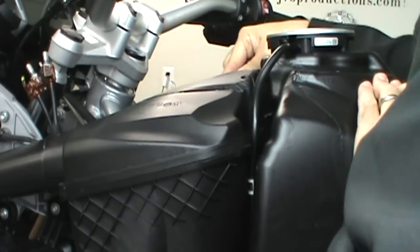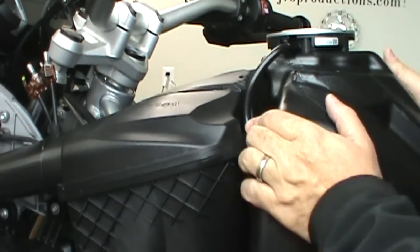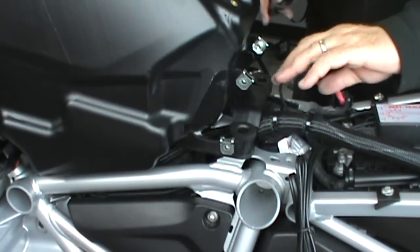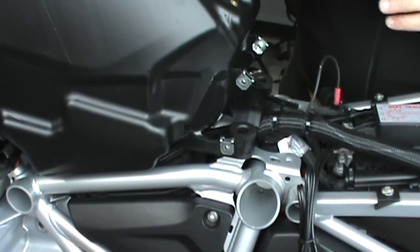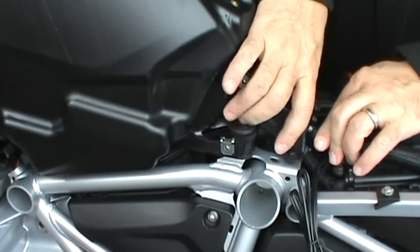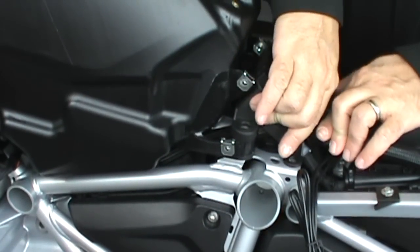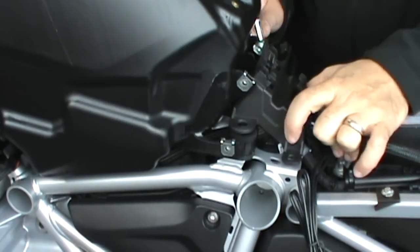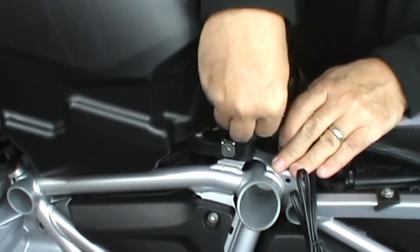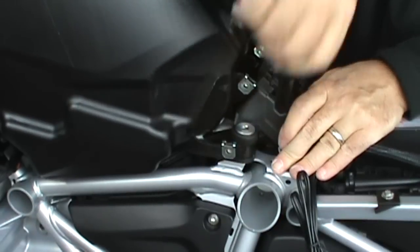If you have keyless, you're going to need to plug it in too, up near the beak. Once you get the tank lined up, it's time to put the retainer in place. Put it down, and then you use the two spacers to hold it in place. Push in the sleeves to line it up with the tank, and then make sure you push the tank into place so you can get the bolts in.